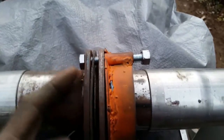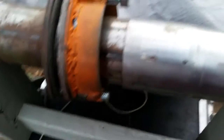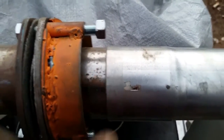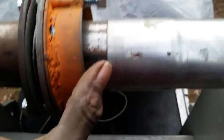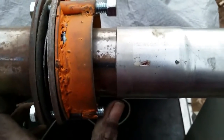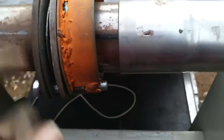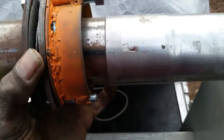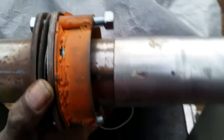If the other part of the flange also has a problem with fatigue or warping, a second bracket can be installed on that side. Simply add another set of bolts about an inch and a quarter or an inch and an eighth longer, and then both brackets together can actually sandwich both sides of the flange, giving you the reinforcement required to prevent the recurring leak through the gasket.